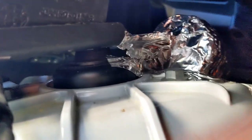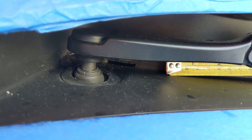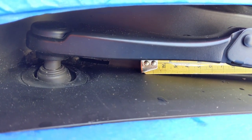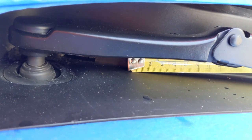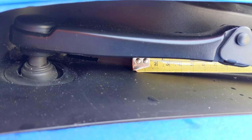That lip right in the center behind the water flow is the lip it used to hit. Despite the water hitting the back of the strut tower, there doesn't appear to be any water spilled forward on this side. The left side has been moved in about an inch and a half inward from the old opening, and extended to approximately 22-25 millimeters long by three millimeters wide. There are still substantial problems with water overflowing laterally on this side, and I'm not really sure how to block water going out laterally from hitting the charge port assembly, so I made the opening on this side a little bigger.